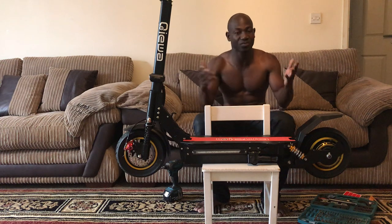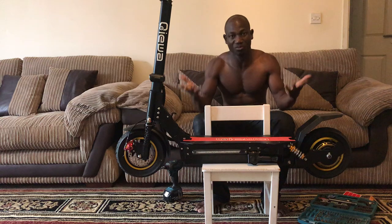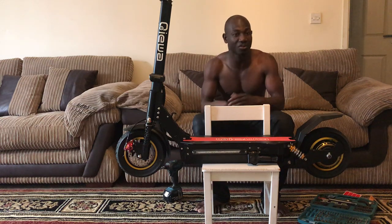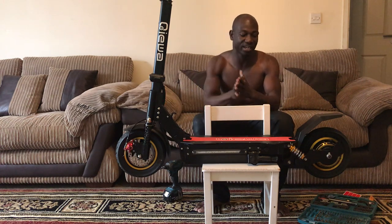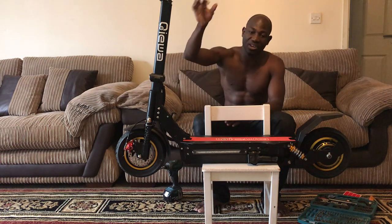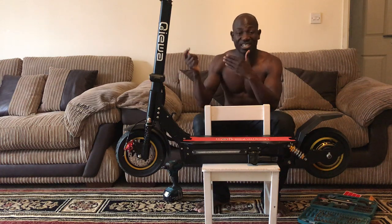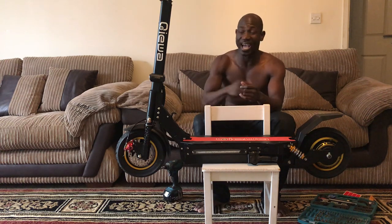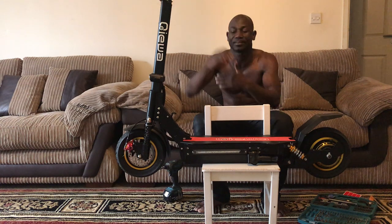I kept communicating with them. They asked what was wrong with the scooter. I wrote to them in English, and don't get me wrong, I don't speak Chinese, so if they wrote something in Chinese to me, I'd probably be struggling as well. They said, send a video, so I made a video of how the thing is. Then they said, what you have to do now is put the scooter off and on, and when it's on, press the power button four times and see what code comes up. I did exactly that, and on mine it came up 0003. So I took a picture of the code on the instrument cluster and sent it to them.